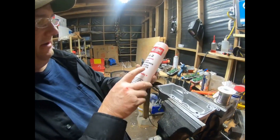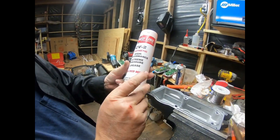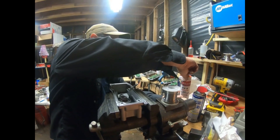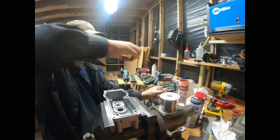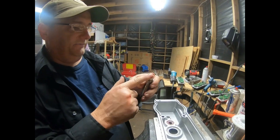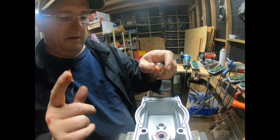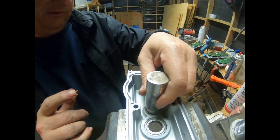I'm using some of this Red Line high-temp grease — high performance, fully synthetic grease. It's made for like 800 or 900 degrees. I'm just packing it around this little piece of metal here and pushing it into the bearing a little at a time.